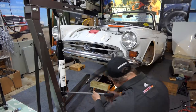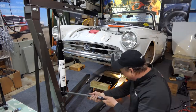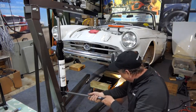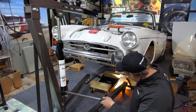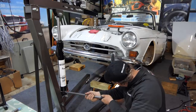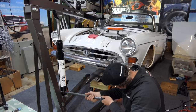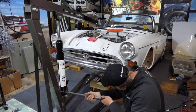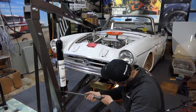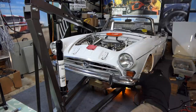So what we're trying to do is lower the engine now — the whole body of the car. The whole engine is going to sit down in that little cradle I made, and I've got to leave enough room to support the tail shaft of the transmission on a rolling jack. Then I've got to get the motor mounts out of the sides once it's on the ground. We're just going to see how all this goes — this is all brand new, trying to see if this engine will fit on this dolly. So let's do it.